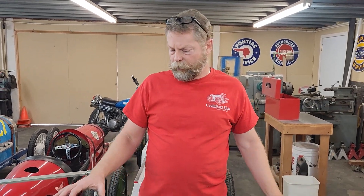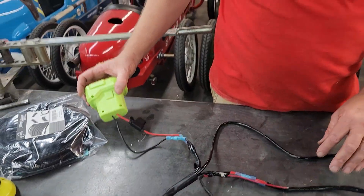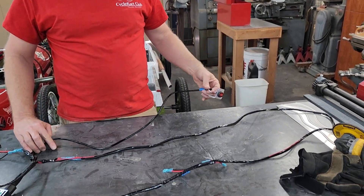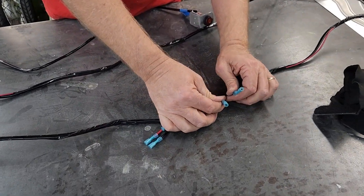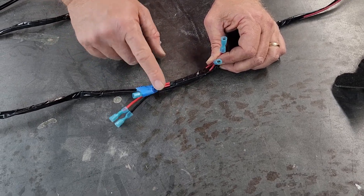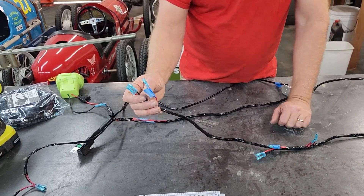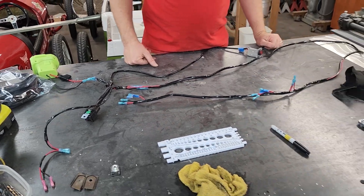We're about to put the wiring loom on the wiring harness. I've got the harness all laid out on the table. This is where the battery hooks up. This is your little relay, your headlight loom, your switch loom, and this is your switch that's going to be mounted under the dash. This goes all the way to the back of the car. This is where the battery power goes to the brake switch — brake switch power comes out and goes to the tail light. So that's the driver's side and the passenger side. We'll put a loom on that and get it ready to put back in the car for the final time.